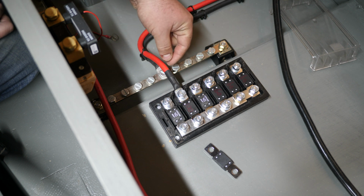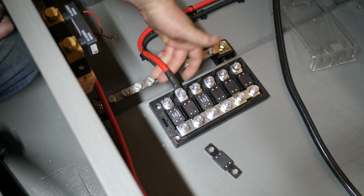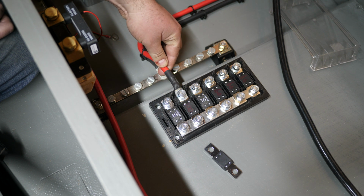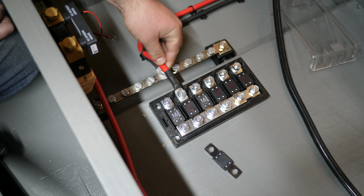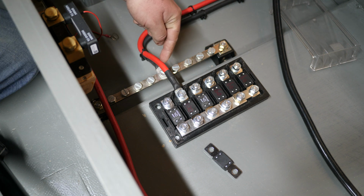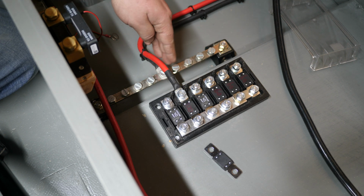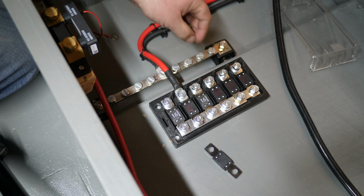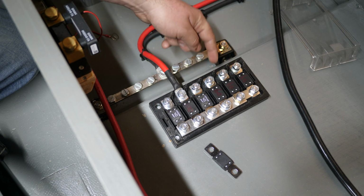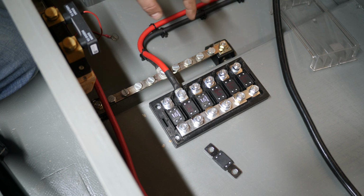And one person online was afraid that this cable could touch this bolt, but as you can see I can put my fingers in between and there's more than enough room, and the cables are really stiff here, so it doesn't move around. And if the positive cable touches the ground bar, the fuse will blow, because fuses are also made to protect the cables. So this is a 25mm cable, and a 100 amp fuse protects that. The 60 amp fuse is for 16 square millimeter cable, and you can look that information up online, and you should really make a plan to fuse all your cables.